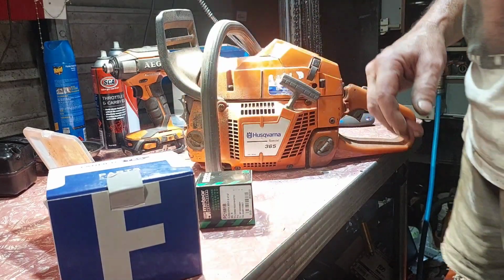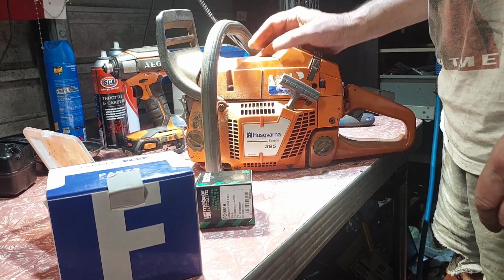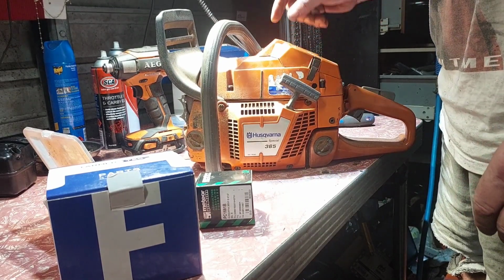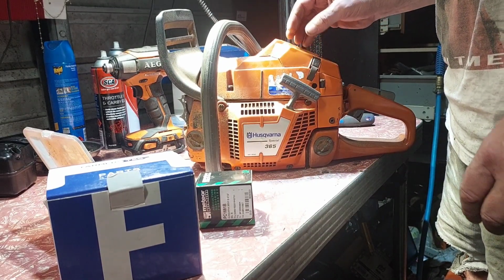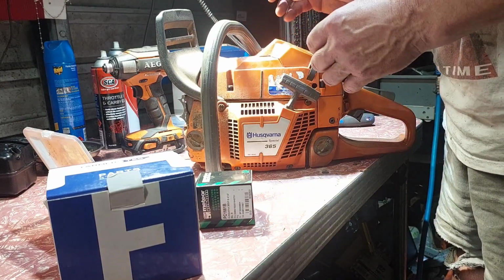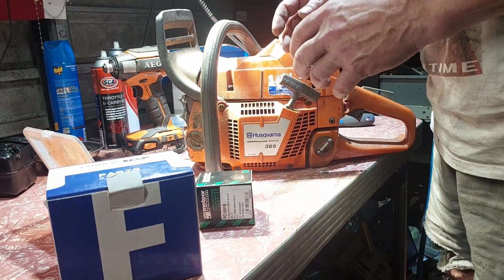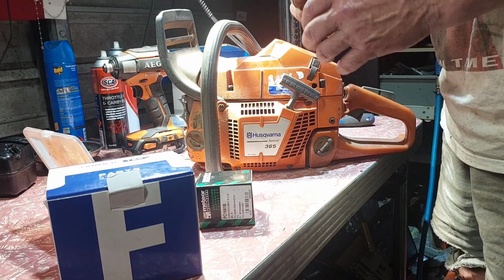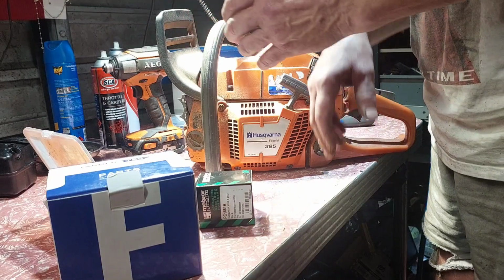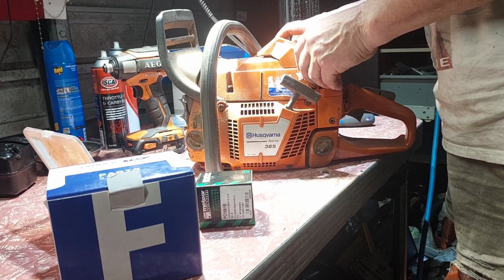No rattling carrying on. Now, what you are with your saws, your regulator, well, one or two things: air and fuel, electricity, fuel, the compression, stuff like that. But with these small saws, because they're small, there's not much room to fill up air and fuel into the cylinder. So you don't need your timing as big because it's full. But if you have a bigger saw, close to, say, 80cc, you need more time to throw the air and fuel in and more time for it to suck and come back down again. So you can get away with a lot more on these saws because they're small and don't need as much.